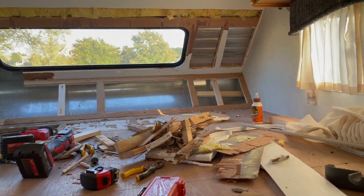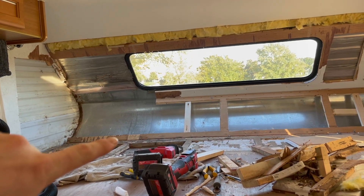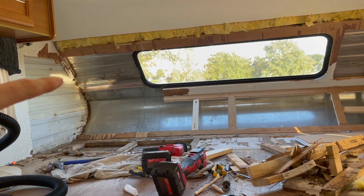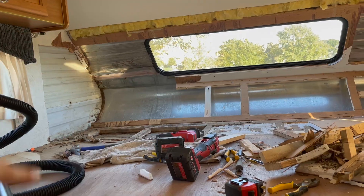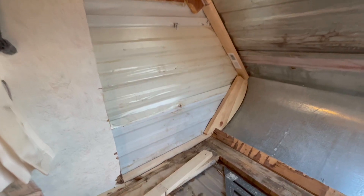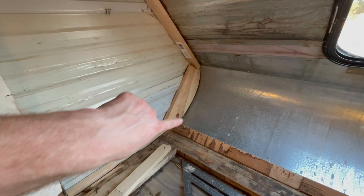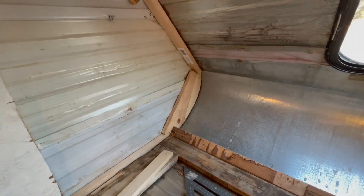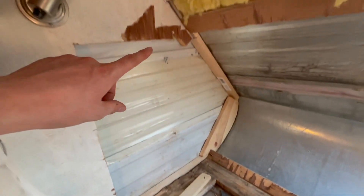Here's a look at our progress so far. Pretty much all of the rotten wood is out of the camper right now, so now it's almost time to start reframing. I've got some pine 1x2s and 1x3s and we're just going to try to build it back how it was, and probably add some extra strength to it - just because there's not much to these frames. We're starting to test fit some wood here. I traced the outside of the camper on that piece of wood and kind of dwindled it down until it fit, and then we're going to continue that frame on there and build frame pieces up from here.